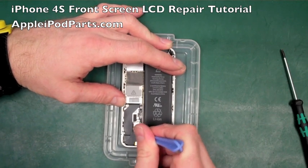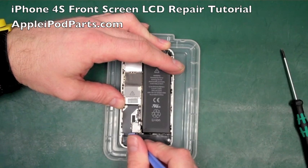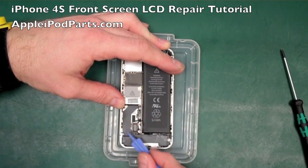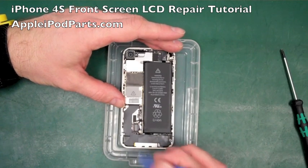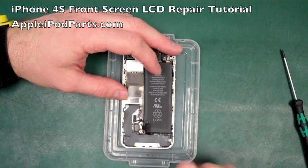We're just going to get a tool to flick under the head itself of the connector, and off it comes. A lot of people go far too deep and try and knock this black connector, and it just tears off the board, which we can repair. You can find links to repair on our site as well. But that's a case of just literally getting that silver plate and lifting it up, and the battery comes out.